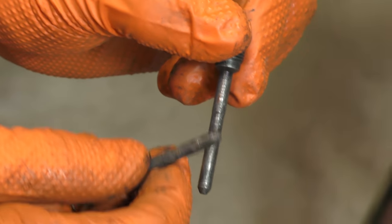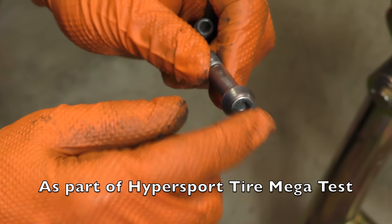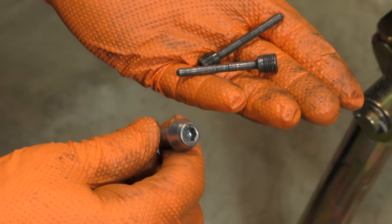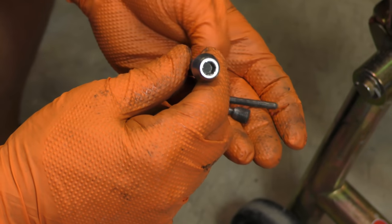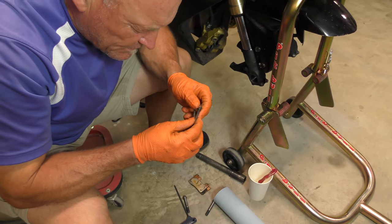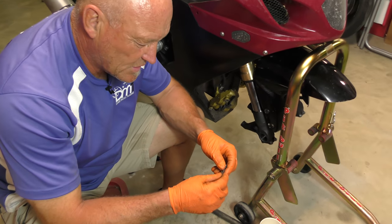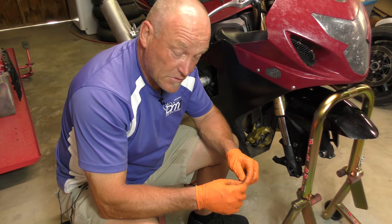So it's getting time to order a set of pins to replace them. And these are not the only wear item either — brake bolts, as these have been changed almost daily, have very soft metal on the heads, so the heads deform. So brake bolts for the caliper are as much a wear item as brake pad pins. So if the tool starts slipping and your allen doesn't quite fit right, replace them because they're not very expensive at all. So at this point we know that that's got a bit of a flat spot on both. So we'll clean them up, but brake pins need to be ordered pretty quick here along with two or three sets of fork seals. So we've got a plan for what we need for the trash-or-treasure bike.